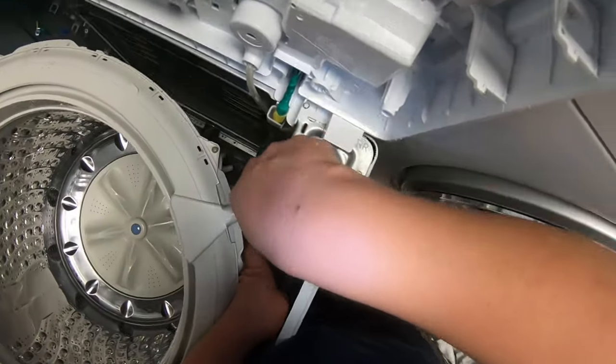Now here is the tubing. Remember we have a clamp — grab a needle-nose pliers and make sure the clamp doesn't slide all the way down into the hole. Go ahead and put the tubing where it goes on the pressure switch and secure the tubing with the clamp. As you see, I'm grabbing the clamp with the needle-nose pliers to secure the tubing in place. Once done, make sure everything is as it was and put the panel back, secured by three screws.